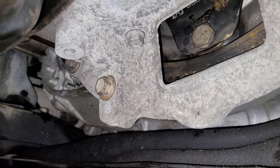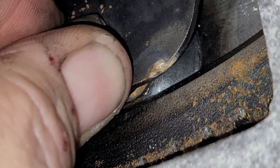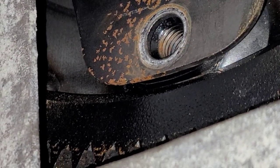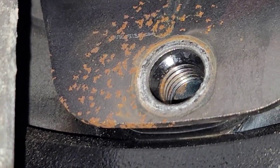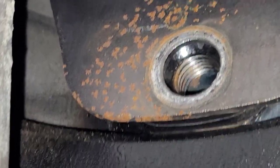What I do is get the bolts down snug — bottomed out but not fully tight — then back them off about half a turn. This way the converter can still move. You can see right now they're just loose enough so the whole thing moves. I can go back and tighten them up. The movement you see and hear is perfectly fine because you want the converter seated properly before final torque. The squared-off hole already has a bolt in it, so those are the tips I wanted to share.